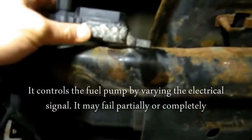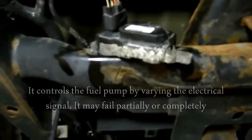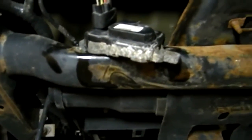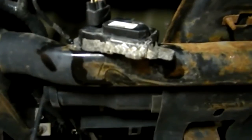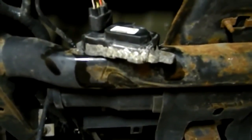If you have a truck like this and it's stalling or it won't start, and mechanics diagnose a bad fuel pump, have them pull down the rear tire and look up at this crossmember and take this thing off. These things are rusting like crazy — this thing should be a recall.